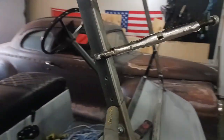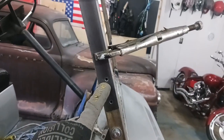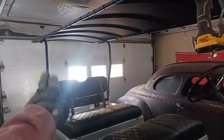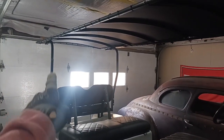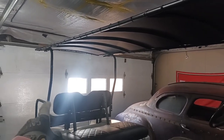There's going to be a bolt here and a bolt up top where this drill is. Those will be my two pivot points. And then this third hole is where I'm going to have a pin that just goes through there — we'll be able to take that out. Do the same thing back here on the rear on these two posts, which I may end up having to make straight up and down because those are angled.